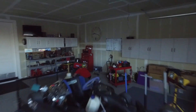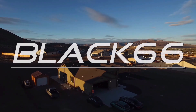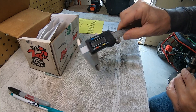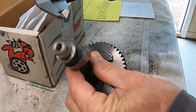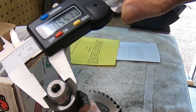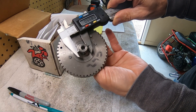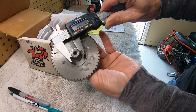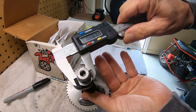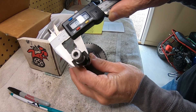If you have a digital caliper or even a dial caliper, you can measure the mains to find out if it's hemi or non-hemi. 0.557 or 0.558 is a non-hemi, and if the mains are 0.550 that would mean it's a clone or a hemi. This one here is a non-hemi because it's 0.557–0.558. You can measure either side on the main — this one's 0.557 — so the non-hemi mains are a little bit bigger.